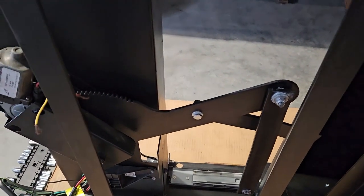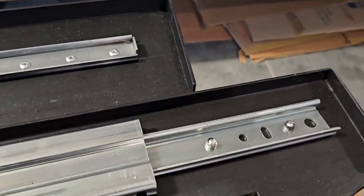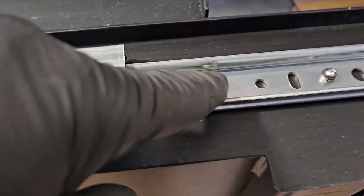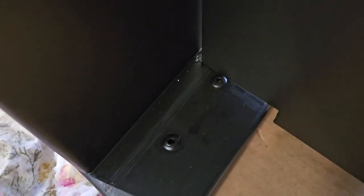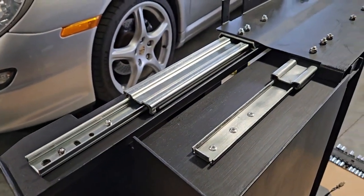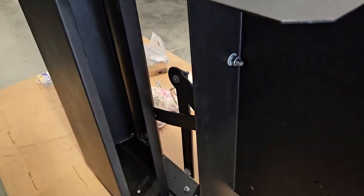When I took this apart, the rivets in the bottom step had the blind part of the rivet on the inside of the step — not very nice looking. So now I've got the top part of the rivet on the step. I'm going to put the stainless steel cover over it, so that's why I've left it in black — it's a rust prevention paint.